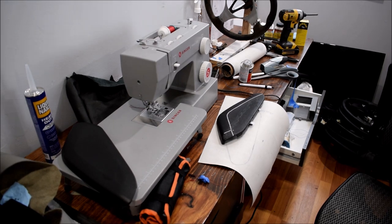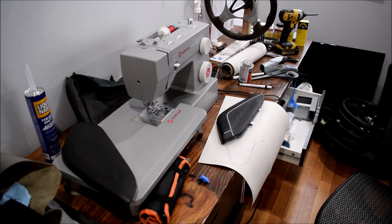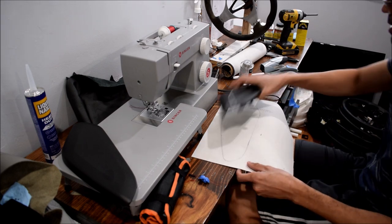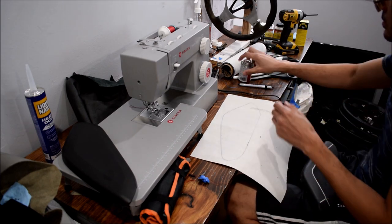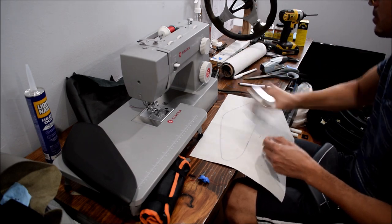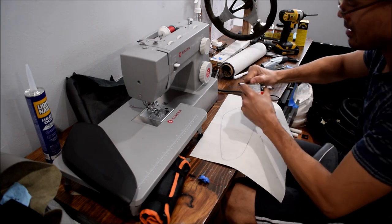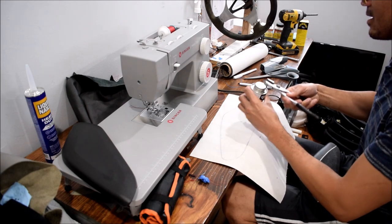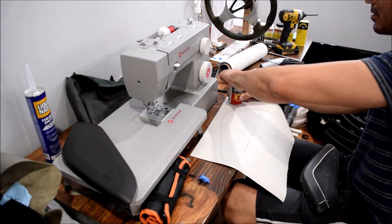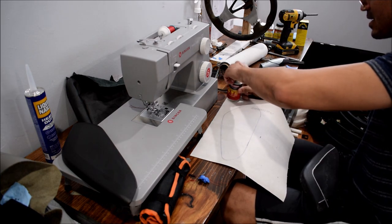And of course it's gonna smell horrible in here, so I'm gonna turn on the fan. Contact cement's probably not the best thing to be breathing. If you can do this in a wide open area, I recommend that. You want to shake this stuff first. Believe it or not, there's a solvent and a binder in this, so you want to shake it, or else you'll take the thin stuff first and be left with just the thick stuff on the bottom, and it hardens and dries out.